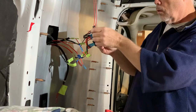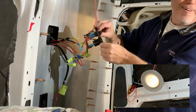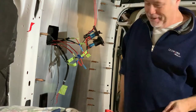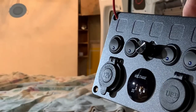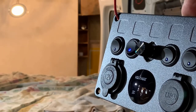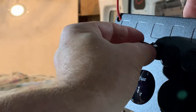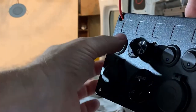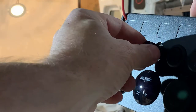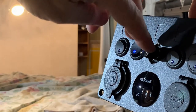I have now placed a fuse in the fuse box, and we're live for the first time. It works! Here's a close-up of the panel with one connected LED in the distance. Although the dimmer switch itself has its own on/off functionality built in, I have chosen to install a separate switch just for this purpose. This will allow us to select a brightness level and leave it there, rather than having to manually adjust brightness each time we turn the lights on.